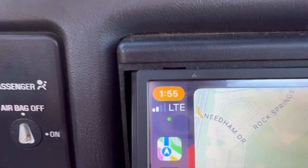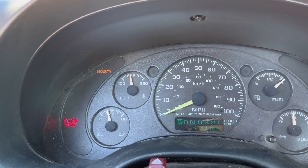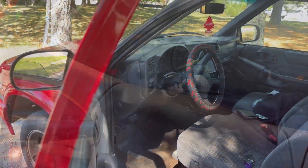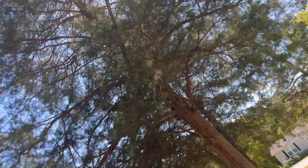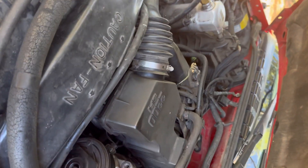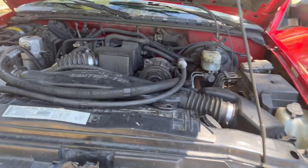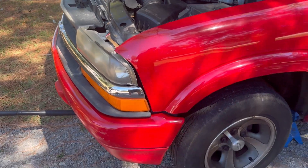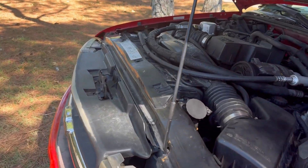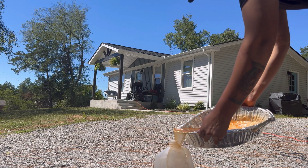All right, it's been 10 minutes. We're gonna check on the temperature gauge and make sure it is not overheating — thumbs up. We jack the truck back up, we're gonna open it up and let it cool down, because we do not want boiling hot water in our faces. Now we're gonna dispose of the old coolant and put it back into the bottles we used.